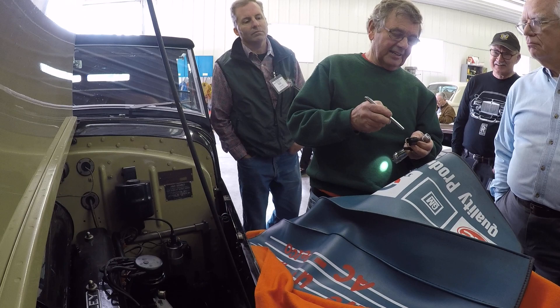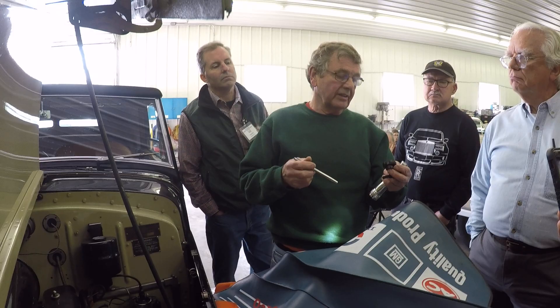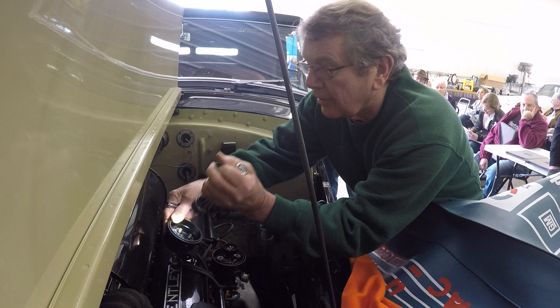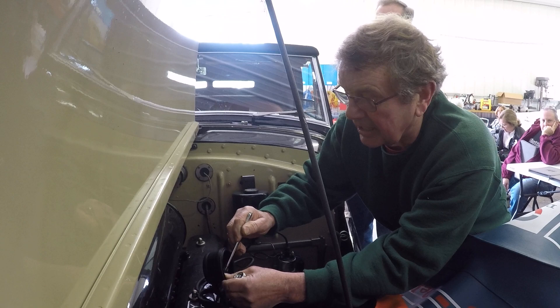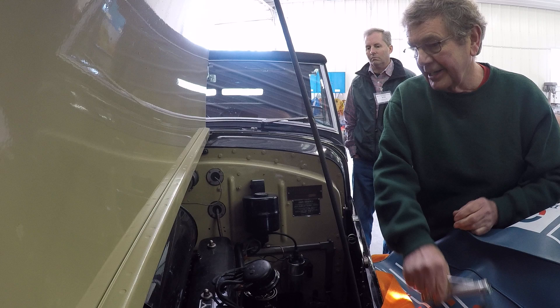This is interesting. You can see there's a small amount of resistance there on this rotor — this is an original rotor. I don't even know if these are available anymore; I don't think they are. Generally they've done away with those, but that is an original rotor. You want to make sure you don't have too much resistance here, because if there's a lot of build-up of carbon on those, a little scrape on there might save you a bit more when you pull that thing around. So it's worth looking at that.